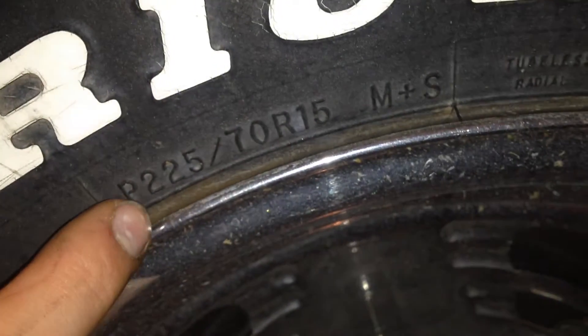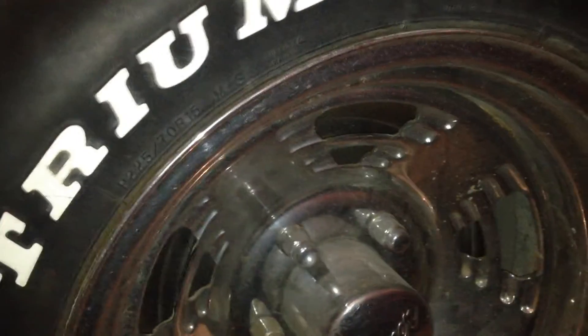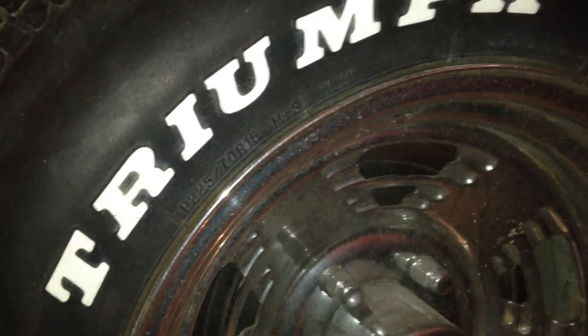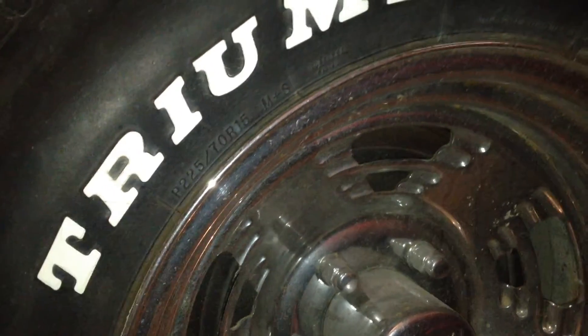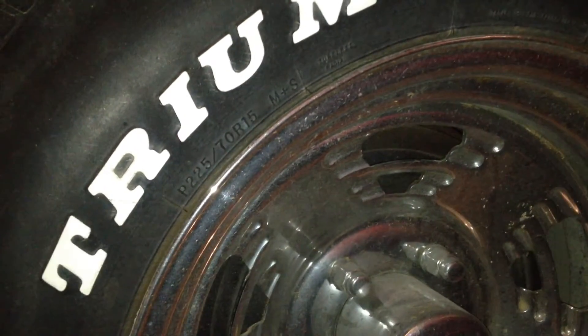I'm calculating the driven gear size I need. One thing you need is your tire diameter. The site I'm using — I'll put the link in the description — you put in your width, your ratio, and your rim size. So P225/70R15: 225 is my width, 70 is my ratio of width to height, and 15 is the rim size. You need to know your wheel size, your rear end gears (mine are a 3.36), and your drive gear — that's how you calculate your driven gear. With my combination, that gives me a 17.2 gear, so close enough to 17, which is going to be really close to spot on.